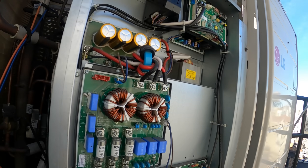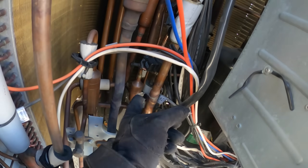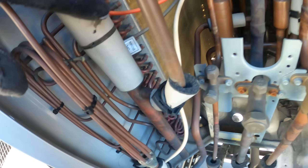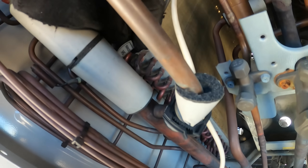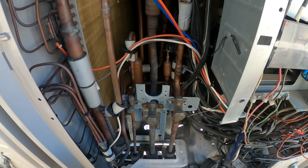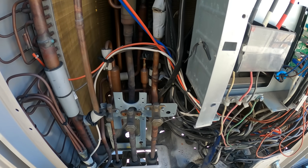I just traced out this wire — it's the SCN, and it is a 5K thermistor. They're both 5 kΩ thermistors and they're reading the same thing, which matches up with the chart. These thermistors are good.